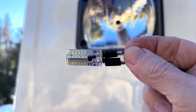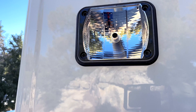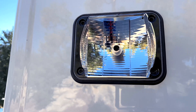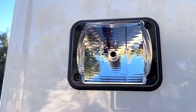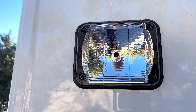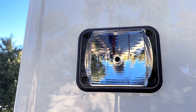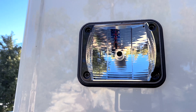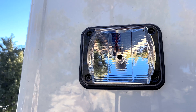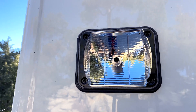I don't have to worry about leaving the doors open and using an excess of energy. These LEDs are DC — that's a really important consideration, because the lights in the ambulance are DC. Hopefully this is helpful, and I will put the information below the video. You can go from 60 watts to 3 watts or 5 watts. The 5 watt is probably the closest you'll get to a 60-watt halogen, but they work great and they're very durable. See you in the next video.